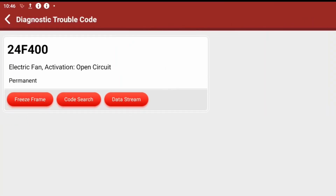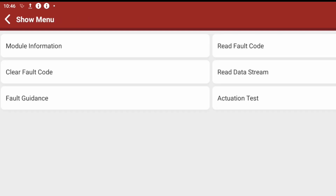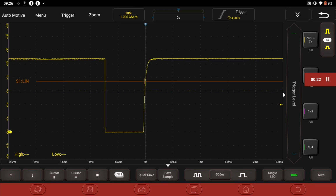We are again at the same fault code as what we had on ISTA, except I used a Thinktool this time, and I managed to get it erased because I fixed the LIN. Happy days. In this frame, which you're going to see now, and that's what we call the method of communication on the LIN, you'll see part of a field which is called a synchronization field. You can go online and Google that. I'm not going to go into those 3 fields, which would be break, synchronization and then the ID.